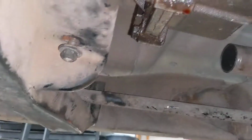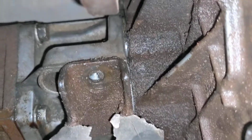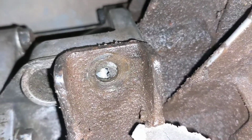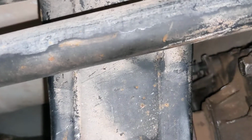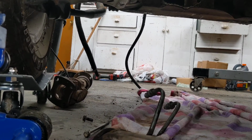And if you notice, it's just kind of loosely attached. But here's the moneymaker. If you look at the bolt for the mount that goes to the transfer case adapter, you will see it's not perfect, but a little bit of shimmying, and you'll see that it actually lines up with the threads. I think I just need to shift it. Like I said, it's just loose. It's actually attached by one bolt on each side. But that'll work.